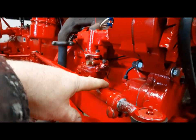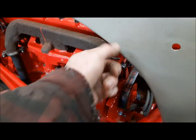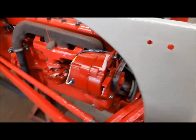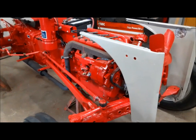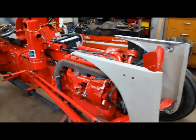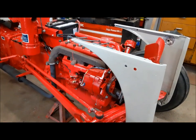You don't want to rotate it down too far or else when the axle pivots the drag link will hit it. We've got just a little clearance there — about three fingers' worth — and that's about as good as you're going to get it. Another little tip of the day: if you're like me and think these modern alternators look kind of out of place on these old Ford tractors, just paint the thing the same color as the rest of it and it disappears. They really look odd when the whole tractor is nice shiny bright red and this blob of cast aluminum is hanging out the side. So I paint them to match and they kind of disappear.